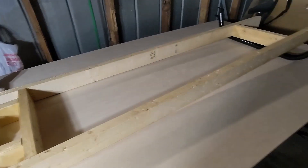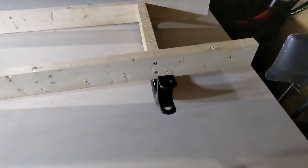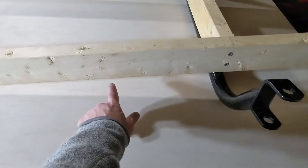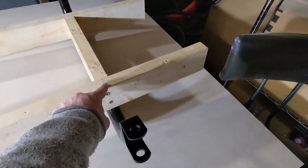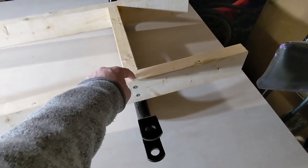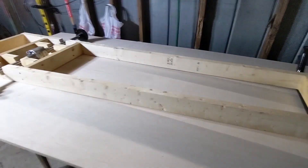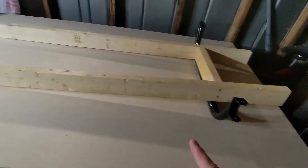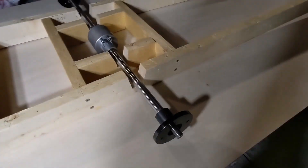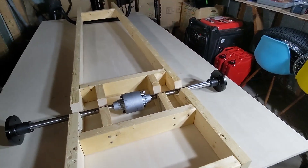And the front end — do some shaping here to give it a nice curve. The leaf spring attaches about half an inch below here, and there'll be a rocker here. It's about 25 to 26 inches from end to end with 13 inches at the center point, which gives you about 12 inches here. I need to double check and make sure that my wheelbase is going to be the 62 to 65 inches, which seems to be about the preferred wheelbase for everything to look correct and proportional.